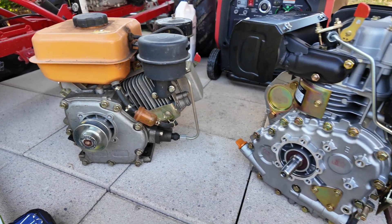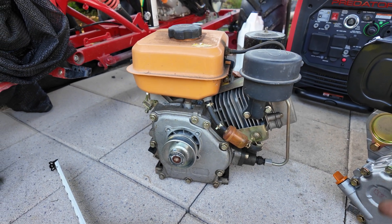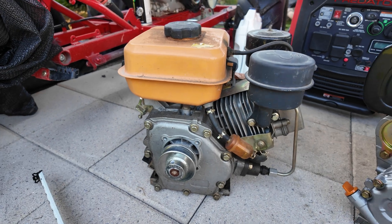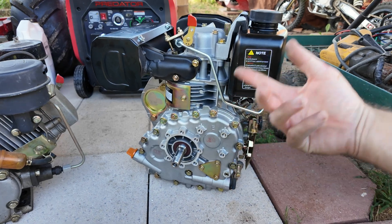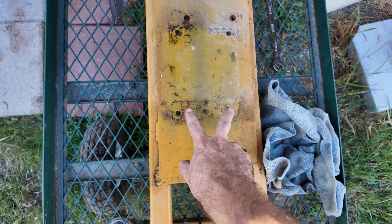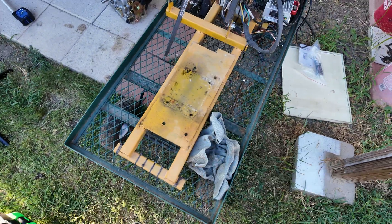Here are the two engines side by side. This one has more of a vertical unique cylinder design; the 247cc looks a lot like the Honda clone gas engines everywhere on mini bikes — like the Predator 212 — except it has an injection pump and fuel injector instead of a spark plug. The biggest downside is it doesn't produce a ton of horsepower, but the pressurized oiling system should increase longevity. Currently this plate is drilled for the 196cc diesel and the 418cc diesel, so I'm going to have to figure out where the new engine lines up.